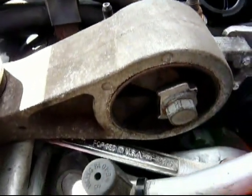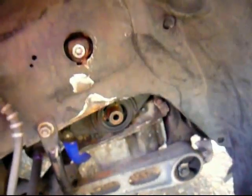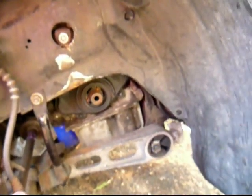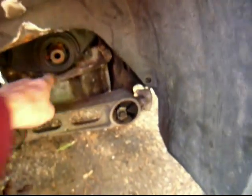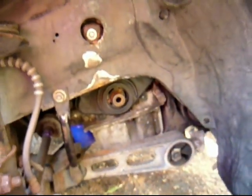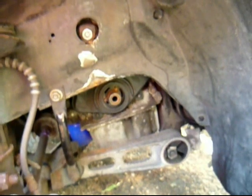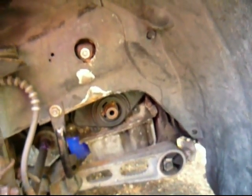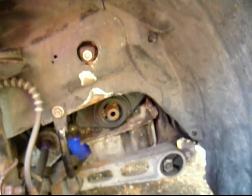And then I'll get these other bolts down to the 85 and thread locker there also. Then I'll do the harmonic balancer to 100 pounds with thread locker. And then I get to put the belts on.